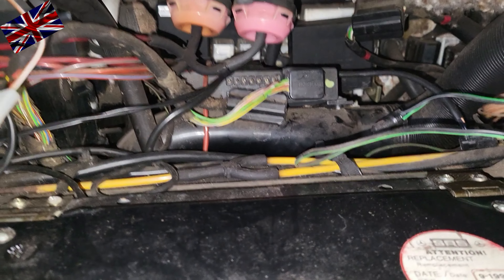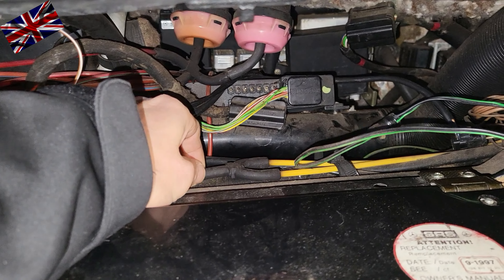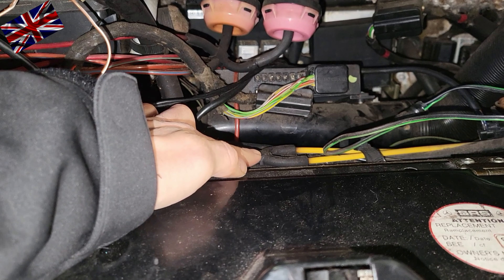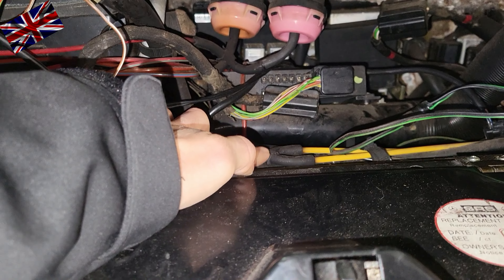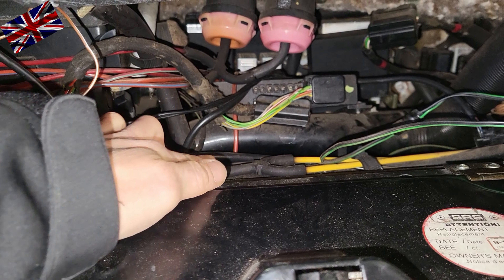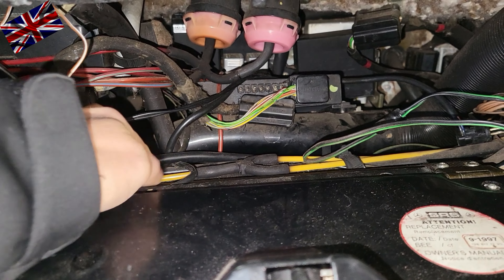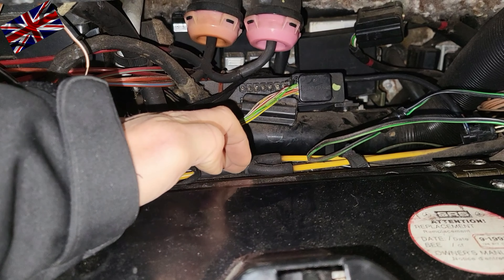When pulling out the glove box, you see the T-split right away. If your vacuum system fails, this is one of the first places to look. This T-section often loses its flexible and therefore sealing properties and develops cracks, allowing air intrusion. It gets worse over the years and eventually allows air intrusion.